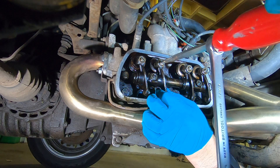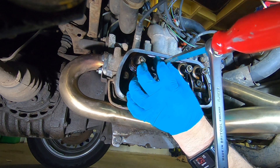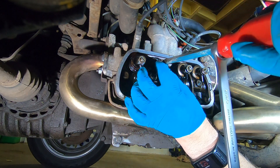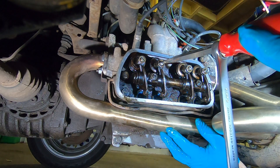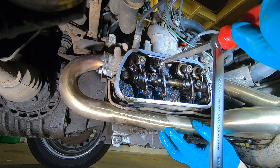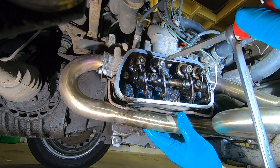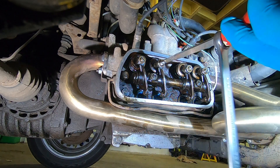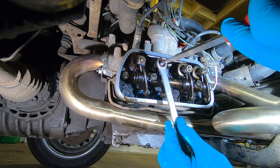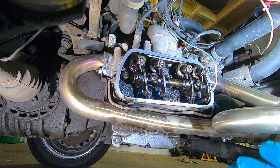Get a feel — it's just touching. So that is three o'clock. Half, one, one and a half, two. That's from three o'clock. Then tighten up the lock nut. And that's them two done.